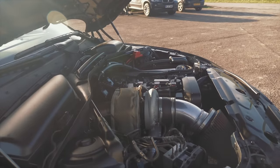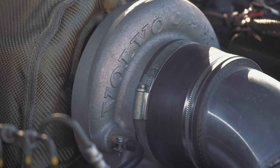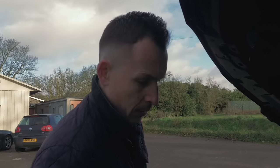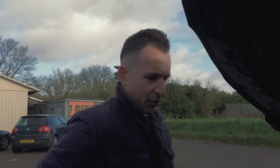So you actually bought this as a project, you say? Yeah, I bought it as a project. Had a few issues, man, wiring issues. She was already situated in there. It was a GE block with a turbo conversion. For people that are unaware, that's a naturally aspirated 2JZ lump, with just a turbo strapped to it. It's the same engine, but with no oil squirters, a different inlet, and a different head.